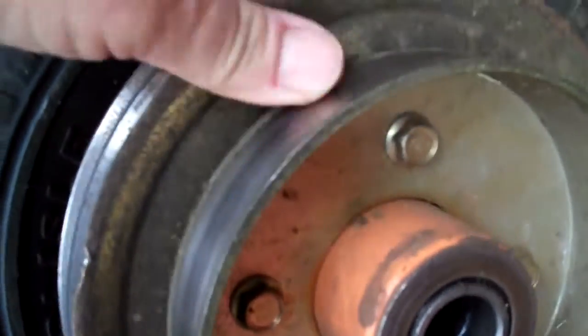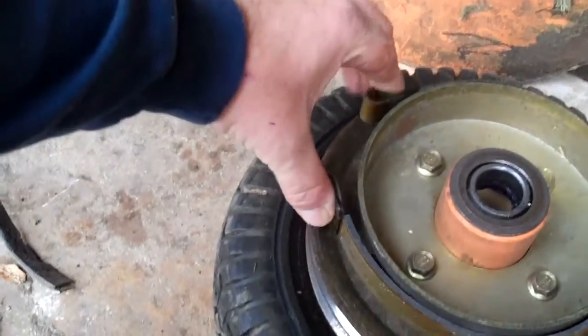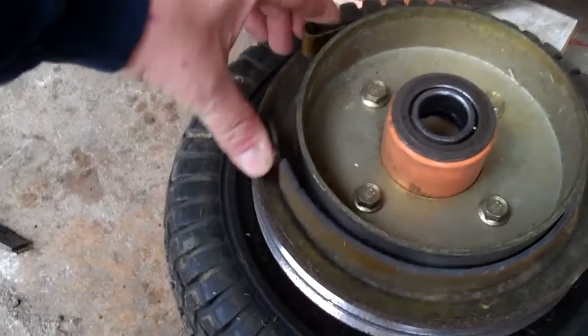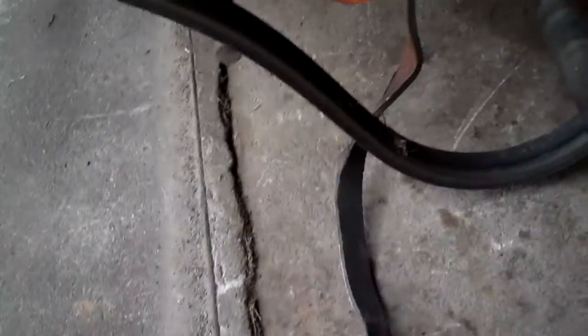This is the back side of the wheel assembly — the pulley for the drive belt — and here is your brake drum right here. The brake band works like this: when you pull the lever, it puts resistance around that brake drum, that's it. Let me pull off this screw — you can see here's the old brake band; it's kind of beat up from moving around to get in here.